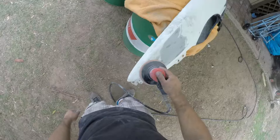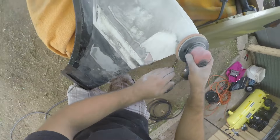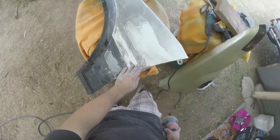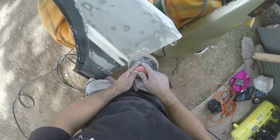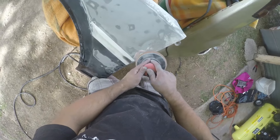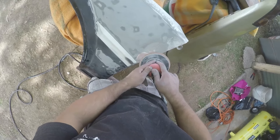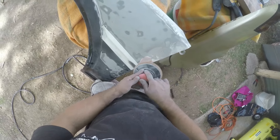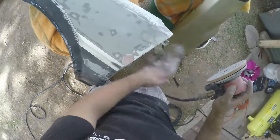The first thing I decided to do was to straighten the guard out as much as possible. It's extremely obvious that I'm not a professional panel beater — I'm approaching this job just like everything else I do, making do with whatever tools I have and objects I can find around the farm. Once I started to get the panel a bit straighter, I proceeded to remove the acrylic paint much the same as the rest of the car. I came across some filler that was so deep I had to break out the wire wheel to remove it all — the filler must have been five or six mils deep.